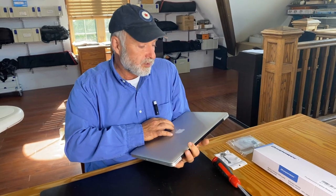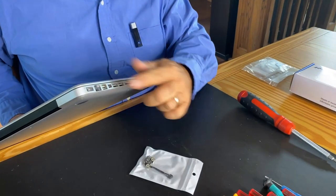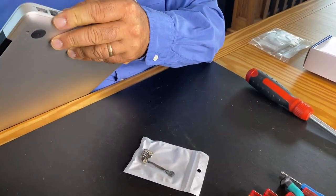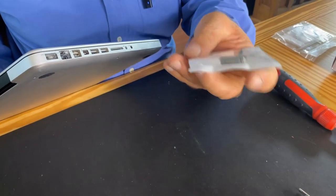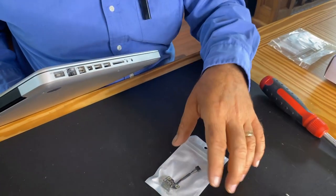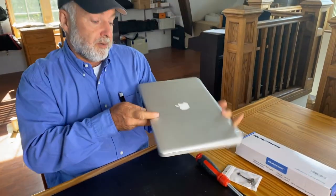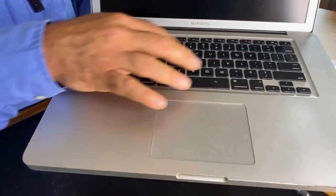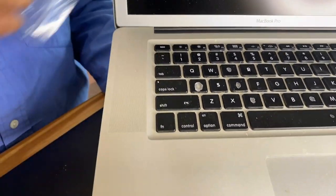Battery life isn't what it used to be, and this charging port needs to be changed — the contacts are getting corroded and don't work reliably. In order to replace that part I basically have to take apart the whole laptop: fans, hard drives, everything's got to come out. Also, I use my laptop so much that I actually wear out keys. This is the third, fourth, or fifth time I've replaced keys on this particular laptop. Here are the replacement keys, ready to go.